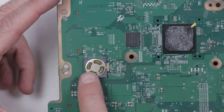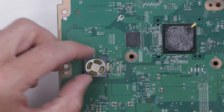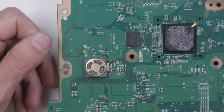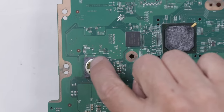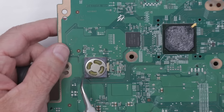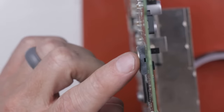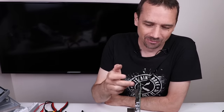This is the speaker and circuitry for the Taco Bell Special Edition Xbox One X, and this is what it looks like on just a regular Xbox One X. I'm hoping I can place all these components and speaker onto a known good board and then it will work. I don't know if this will actually work, but I really want to save this Taco Bell Special Edition Xbox, so I think it's worth a try. The first thing I'm going to do is see if I can remove this speaker cleanly — that's the part I'm most worried about. There are four pads that it is soldered onto the board with, so I'm going to heat it from the top side and see if I can get that to loosen and remove it. All of this around here is plastic, and obviously there's plastic on the inside along with a coil of wire. This is going to be super difficult to remove and still keep it intact.